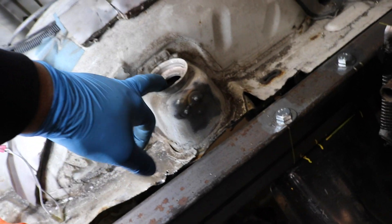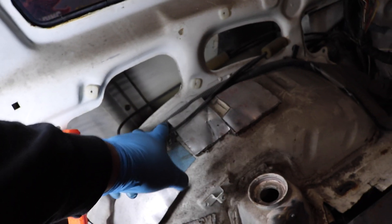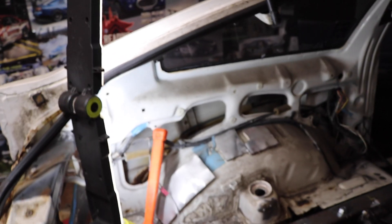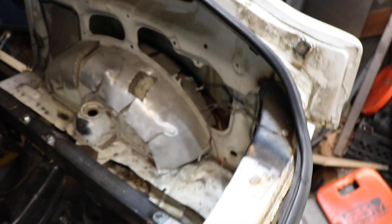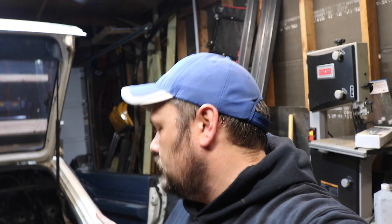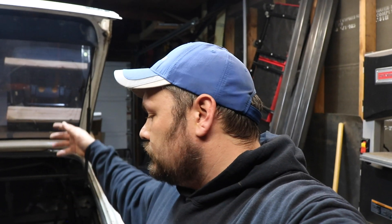This is where the shock mounts, and on the other side of this is where the spring goes. I'm just going to zip it right along the top of here, trying to leave as much of this intact as I can. Obviously I've got to get all the wires and cables and everything out of that side. Let's start on this side because I don't have any of that — this side's super rotted out anyway, so I don't feel quite as bad. The next step is to show you why I did it the way I did: this entire unit will drop out as one assembly. The way you do that is the engine crane comes through the hatch, supports the engine, you drop the cradle, the rear trans crossmember, and the whole thing drops out.